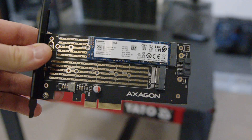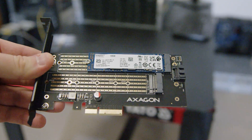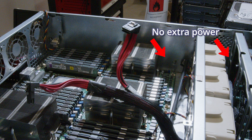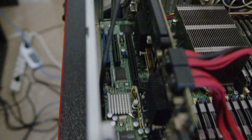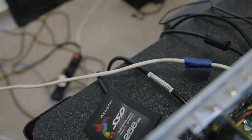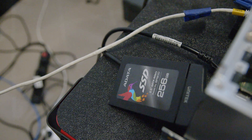Going back to the topic, I bought another similar pass-through, this time with M.2 SATA output. You may ask why I even bother with PCIe pass-throughs — the system has no extra Molex or SATA power cables available, so I'm basically using this card only to power my M.2 SATA disk. I also tried a USB option, but only USB 2.0 was available — speeds were slow and I didn't like the drive dangling inside or outside the chassis.